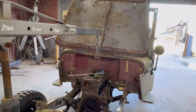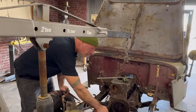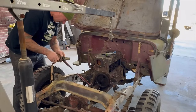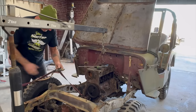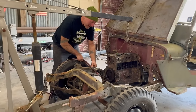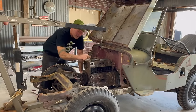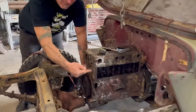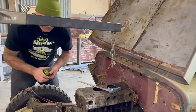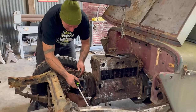I'm going to put a little strap to hold that at thirteen. We're going to build one at a time. Here's today's question — what's a camshaft? It's the thing that turns the gears to make the transmission run? Incorrect. Sometimes called a bump stick, it has lobes on it. These little valves go up and down — the camshaft has a series of bumps on it and it causes them to rise up. It makes the valves go up and down. Also turns the distributor and a fuel pump, but that's outside of our scope of conversation for the moment.